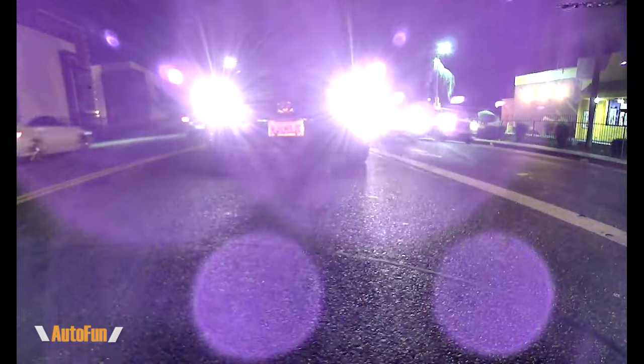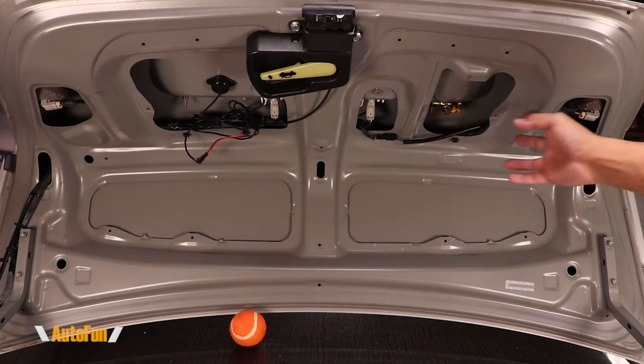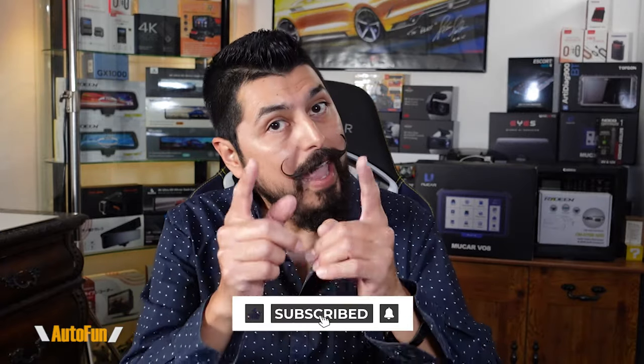Going back to the rear camera, there is a plunger on it which is really just a switch that enables the pairing functionality, especially if you're going to add more cameras. This particular system came already paired when I received it, so I didn't have to go through the pairing procedure, but that's what that button does. If you're curious about how I pull power from the vehicle to power the camera, I've already made a video on that — I'll put a link in the description along with a link to the V3 wireless backup camera system. If you have any questions, put them in the comments below, hit the like button if you found this helpful, and stay tuned as I have more mirror dash cam and backup camera reviews coming. Thanks for watching and I'll see you on the next one.